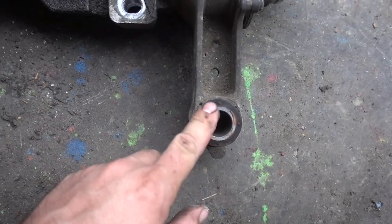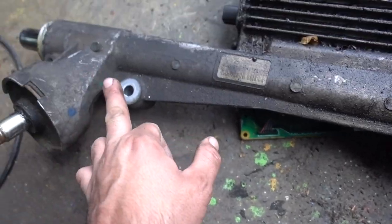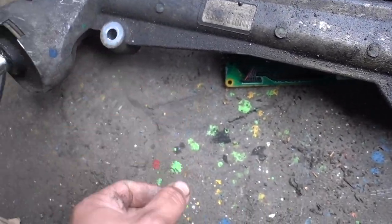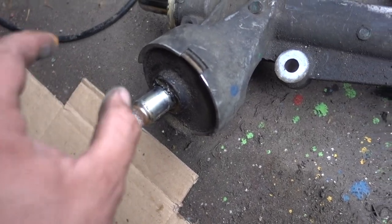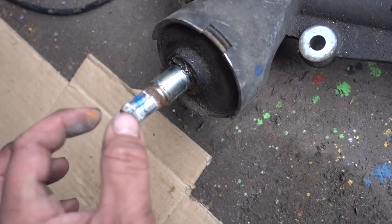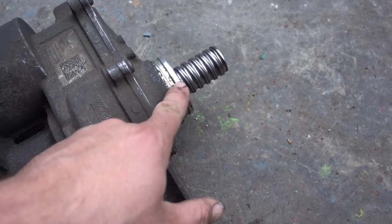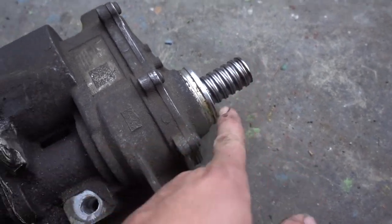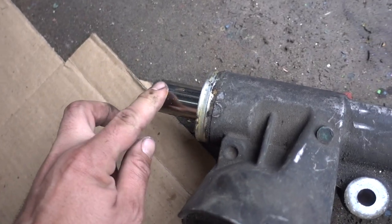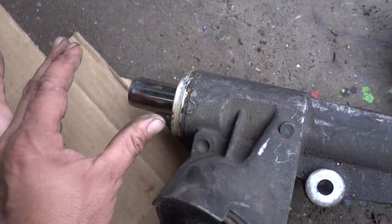You can see this is where that third bolt is in the back — it kind of slides into the K-member, and these are the two where the bolt goes on top. There's also a bolt that goes through here and another one on the column, with a U-joint that goes there. When you're replacing your old rack with a new one, you want to take a measurement of what the poke-out is on these sides and match that on the new one. In theory, you really shouldn't have to get a new alignment if you do that.